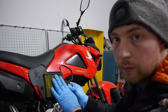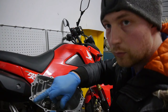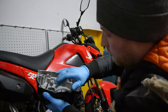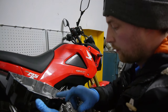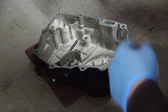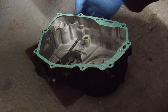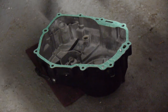I'm going to get this screwed on in a moment, but first I'll get the gasket on and get the casing back on the side of the engine. First I'm going to put a little smear of grease all the way around this surface — it just helps to hold the gasket in place and makes it easier to remove next time so it won't be stuck together and rip apart. Once done, wipe off any excess grease, pop on the gasket, and put another smear of grease on the other side.